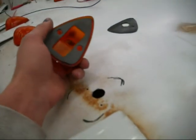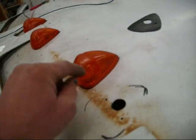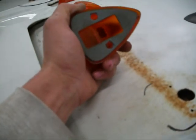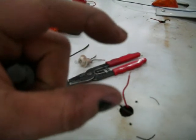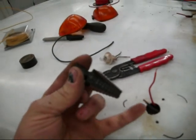The second gens are supposed to screw into these little square plastic blocks — you drill a bigger hole and put the block in there that the screw actually goes into, similar to the way license plates usually mount. But I didn't get those little blocks, just the screws. I tried drilling an eighth-inch hole in the tin and that actually seems like it's going to work, so I'm just going to leave it that way. For the center hole for the plug, I used a step bit — it's a kind of sawed-off step bit. You can't start the hole with it, you have to have a hole started. You only have so much length to go through before you hit the headliner — only about an inch and some change — so you can't really use a full-length pointed bit.